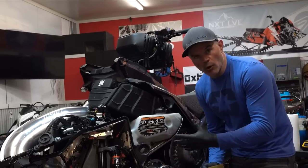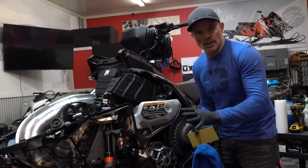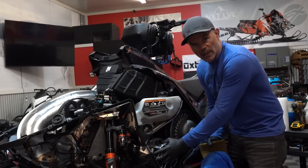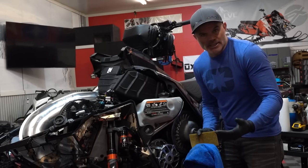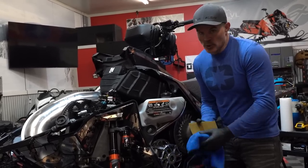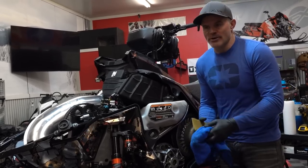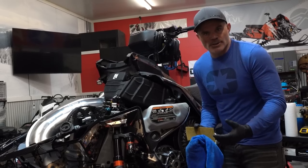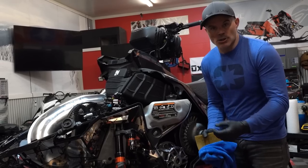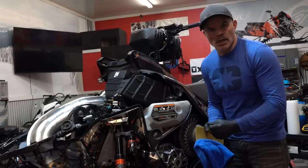Getting into the clutches — we can go deep dive, and you guys have seen plenty of clutching videos. Rather than pulling off the cover and inspecting the primary spring, those are things we'd be doing depending on how much you're riding. A primary spring — Polaris would tell you about every 500 miles — and on a 9R or a boosted sled it's potentially less than that. As you're riding day after day, think about what's happening to those clutch springs.